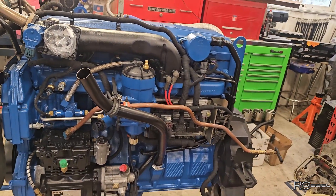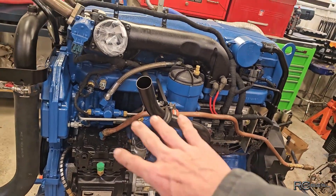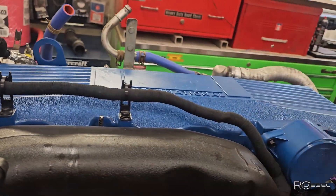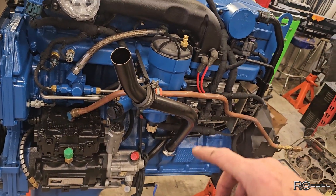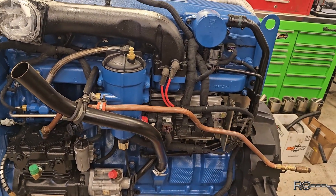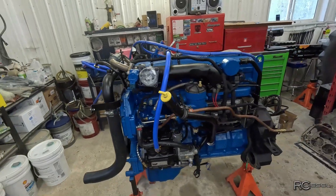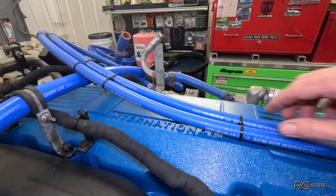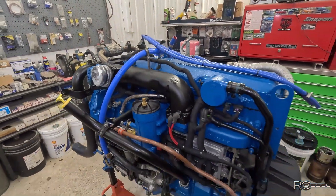I'm overfilling it at this point because once you get to cranking and get all those oil galleries full of oil - remember that big rail up top - once that thing gets full and the pump and tubes and everything are full, we're going to drop the oil level quite a bit. I always overfill them a fair bit because by the time you're done cranking a lot of that oil disappears into all the galleries. Well there we go, this one is finally complete. Got all the little things done - hoses tied up. I made new hoses for the top because the old ones had nicks and rubs and the ends had been cut off.